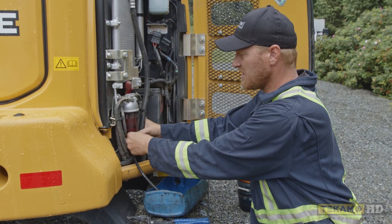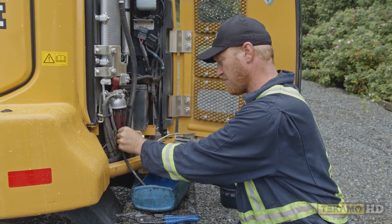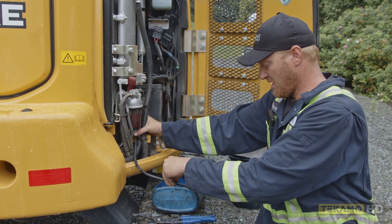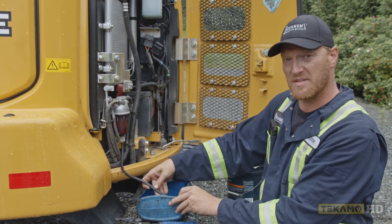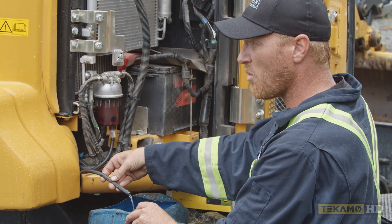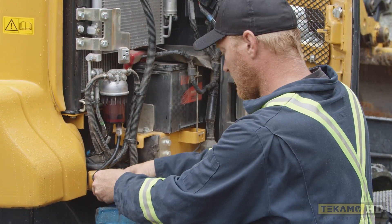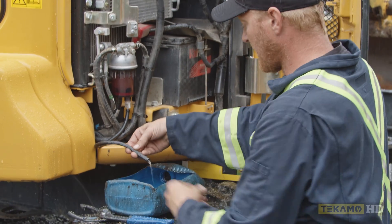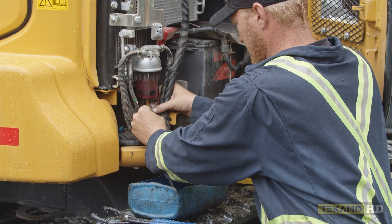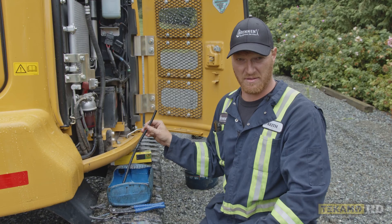So to drain the water, you leave that on and you open the valve. By opening it, you just have to unscrew it. As you unscrew it, it starts to open the bottom. You don't have to take it all the way out, and as you can see, fuel is draining out. Now water sinks to the bottom of fuel, so that water will drain out before fuel. If there's water in there, you wait for it to completely drain out. After you get nice clean fuel like it is now, you can screw the valve closed again. And that's how you drain the water out of the filter.